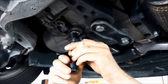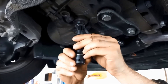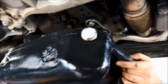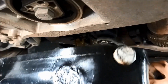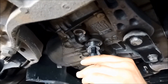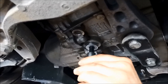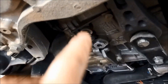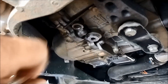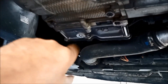10mm allen key. These plugs are 22 mil by 1.5 mil pitch. You can put a magnetic plug on there, just make sure the magnet's not running very close to any gears or anything that's moving in there, otherwise it can magnetize those gears. And we've got the mechatronic oil which is at the front here.